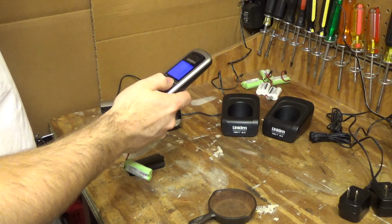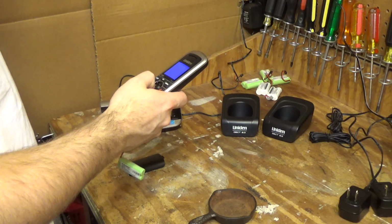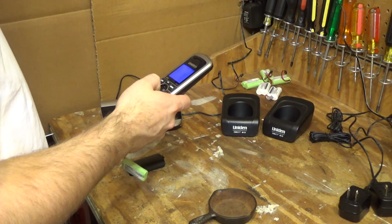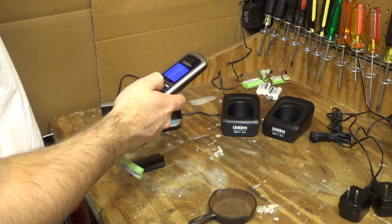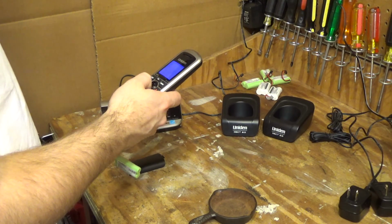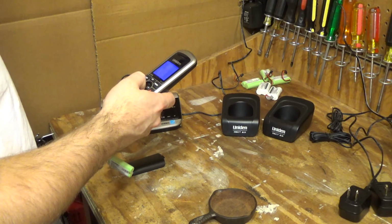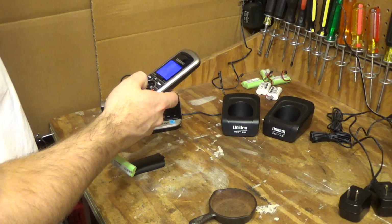Let's go to the answering machine, and we're going to turn the ring time down to 2 rings. It was on toll saver. 4 minutes is fine. Call screen has got to go because it'll just feed back. And then answer mode on, and then we're going to do just the greeting somewhere else. Answer setup.